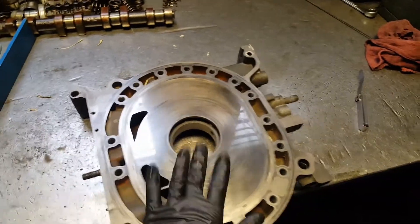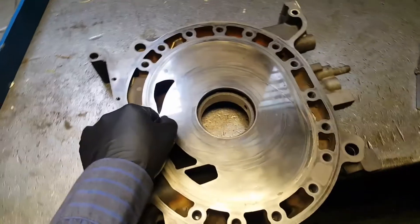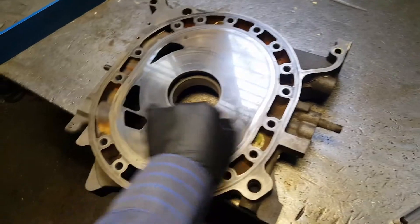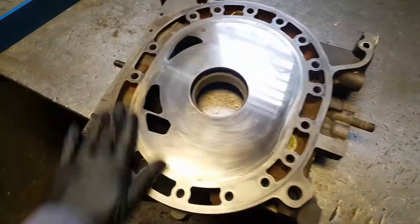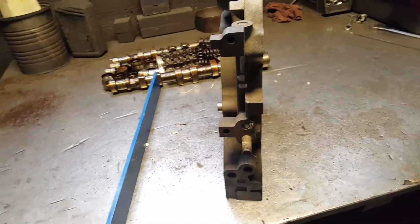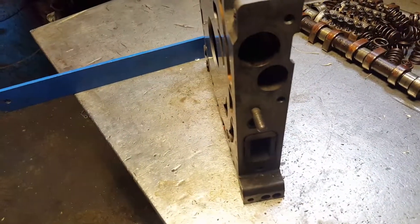Another visual inspection method: grab your thumb, pass your fingernail everywhere across the surface, and your nail should not catch on any groove or deep marks. This front iron is good and ready to use again. Of course, also make sure to do a visual inspection for cracks. As you can see, this one was a six-port.